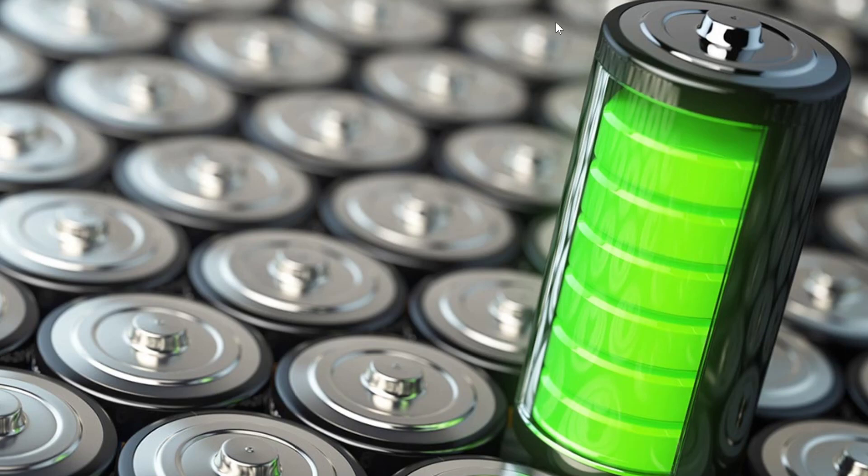These batteries are meant to be recharged immediately as soon as you need to recharge — like on your smartphone. You do not let your smartphone drop to 5% battery every day. If you do that, just after one year of use, your battery is already going to be quite bad compared to somebody who almost never lets it drop to zero. Lithium-ion batteries are not made for big, deep cycles. They're made to give you power. Once you stop using the device, plug it to charge, and you'll always be at 100%. Using them that way will make the battery last a very long time.